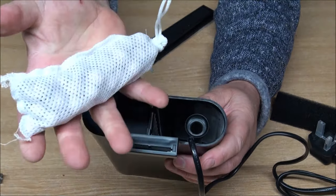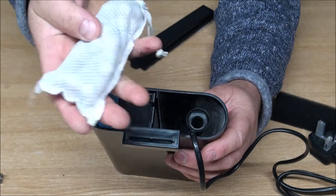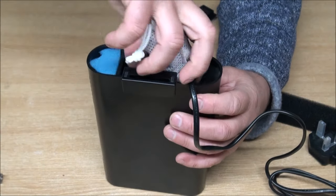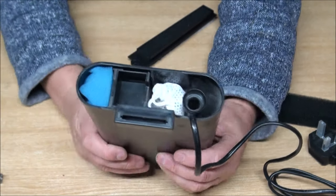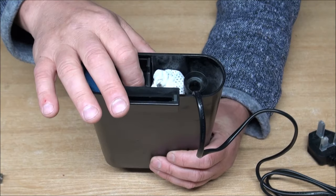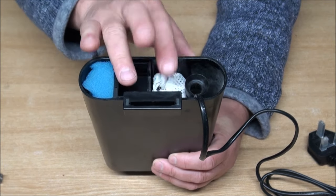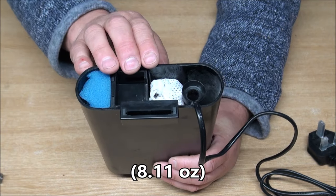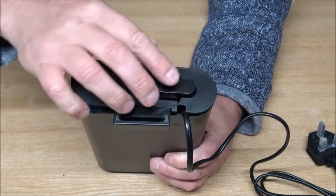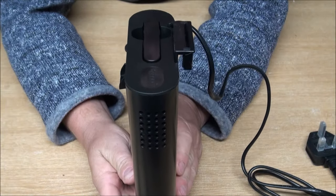That just slots back into the middle there. In our section that originally had the ceramic balls in a mesh bag, because it's so tight and there's no way to get a bigger mesh bag or anything else in there, that can just go straight back in. So now in here we've got a thicker piece of foam with the bumpy bits facing outwards for more contact surface area, we've got extra filter media, and we've got the existing filter media. These two filter media compartments combined hold roughly 230 grams, and then the top can go back on. We're all pimped up.